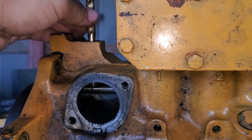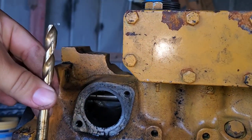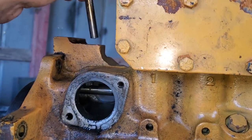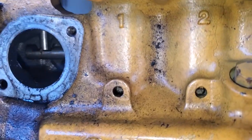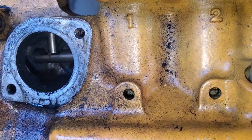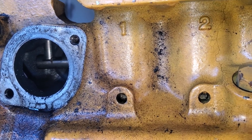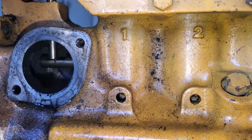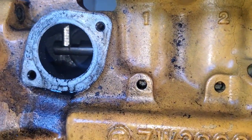Now up top here you have a bolt, and I use the 3/8 drill bit — slide it down in there. Then move your throttle to the open position. That would basically be like you're mashing on the throttle. Make sure that it's up against your bolt there.